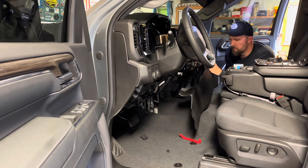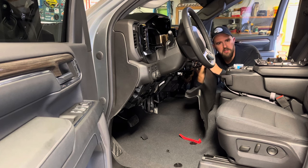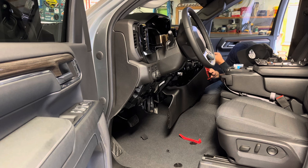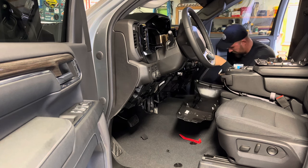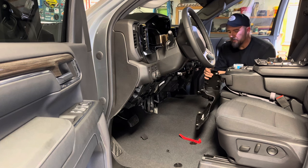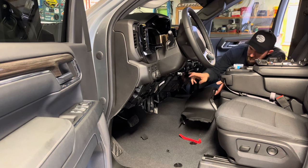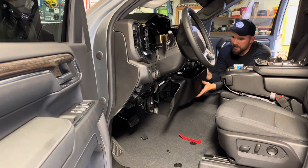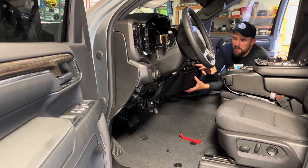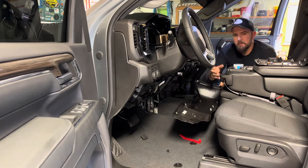Up here on the passenger side, right next to your USB ports, there's a stubborn little screw way up in there holding this whole thing. I unclip the bottom bezel underneath the radio just enough to get my ratchet in there. That releases the whole piece. Now that this panel is out, we can drill it out at the bench to keep debris out of the inside of the truck. This gives us a better idea of where to put the socket — I'm thinking right in the center, underneath the climate control on/off button.